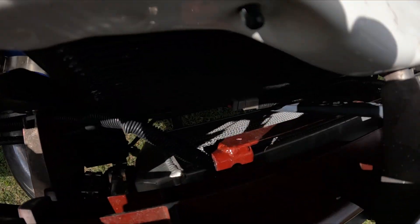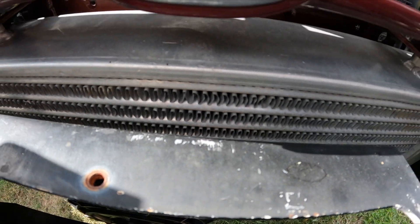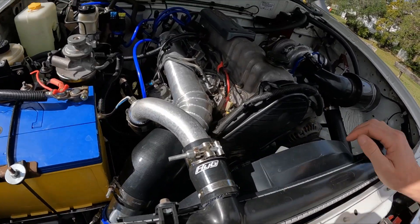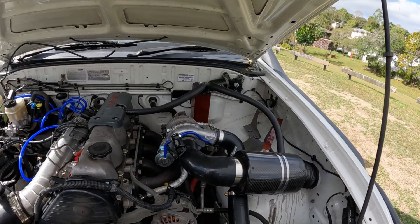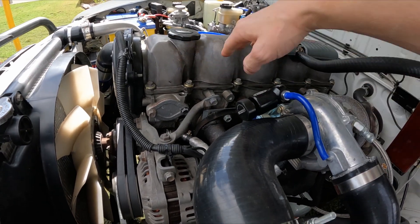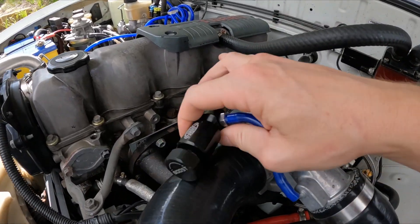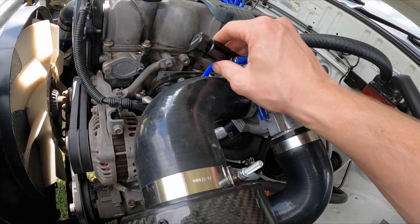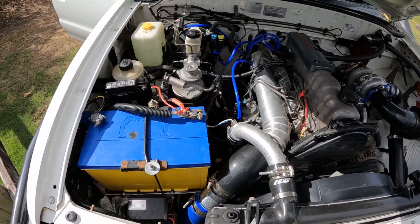The intercooler helps get those exhaust gas temperatures down by allowing for better heat exchange — it lets the intake air cool quicker, which is obviously beneficial. Why does exhaust gas temperature matter? These engines have an aluminium head, so when you get it too hot you can start warping the head, damage the conrods, damage the pistons — all sorts of problems. Before you start tuning boost, you really need an EGT gauge so you know you're not running too hot.